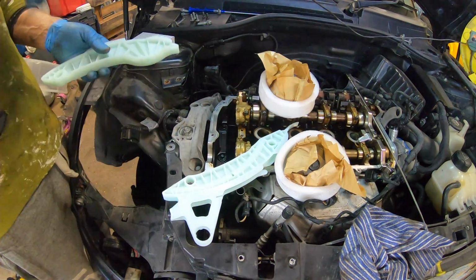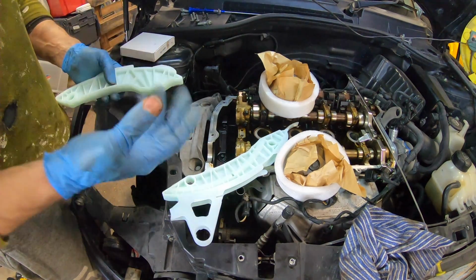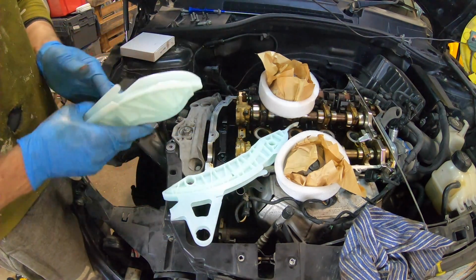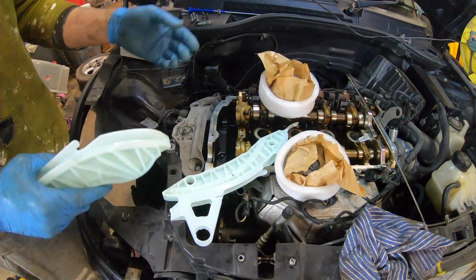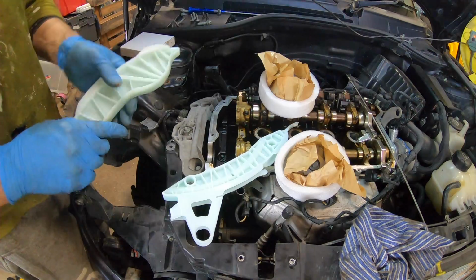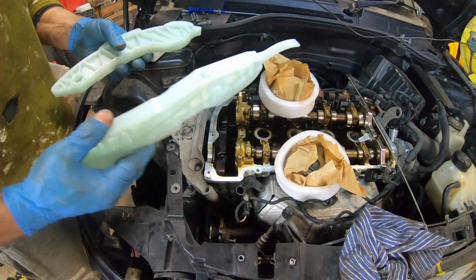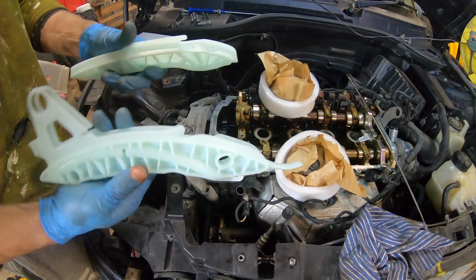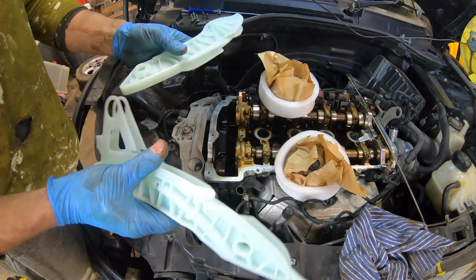you put it together, and you tend to oil a lot of the parts, because obviously when you first turn it on, the oil won't have been moving through the engine, and even if you don't have the coils turned on, you just turn it over, you don't have the fuel supply in, things have got to move when you first start the engine again, and so that means there's no oil in the system. So I'm interested to see that no one's really run much in the way of any oil down the sides of these guides in any of the videos I've seen.